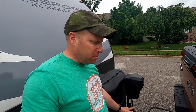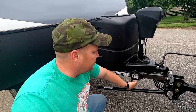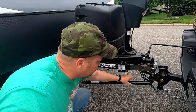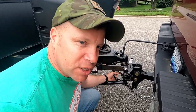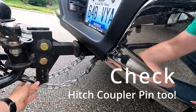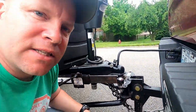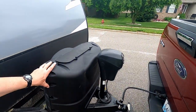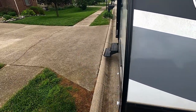Now I'm going to start checking my connections to the truck. I'll check my sway bar, make sure it's good to go, tighten it up, and make sure my pins are both in. Then I'll check my weight distribution hitch, make sure everything's connected. Check the hitch itself, make sure my hitch pin is in, and check my chains — they should be crisscrossed and properly installed. I also have my emergency brake on the chain, so if everything separates the trailer brakes engage. Make sure it's plugged in, check my LP tank cover, and check my battery.